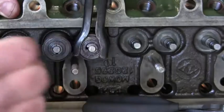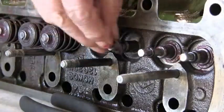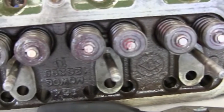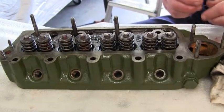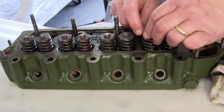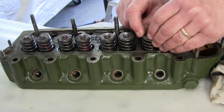All right, now it's fine, I think. There we go, that's it. All the springs are in. Just need to put the clips on top of the valve stems — we're just putting these little clips on top. Very simple to put on. And we're putting them in line with the split in the cotter — the pair of cotters.